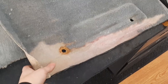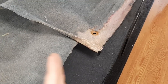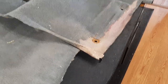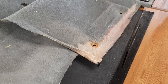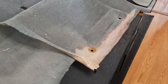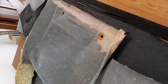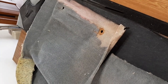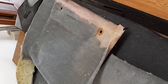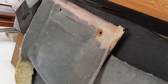I recommend using a battery cutoff. When storing for any extended periods, it's best to remove the battery from the car. This is one of a few reasons I'm not a big fan of trickle chargers when the battery is in the car, because they can overcharge a battery and do this to your carpet. There are two things that will cause a battery to do this: one, if it freezes and the case cracks — batteries when discharged are much more prone to freezing — and two, if they boil over during a charge where acid can come out the vent tubes and leak onto the carpet causing this type of damage.